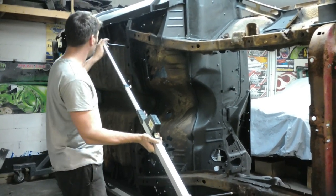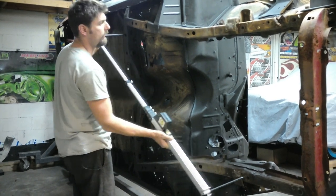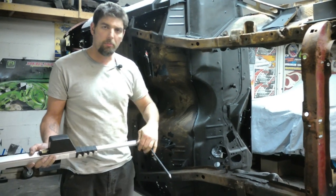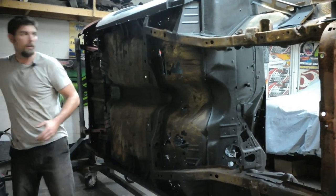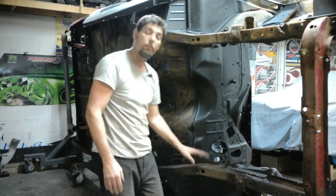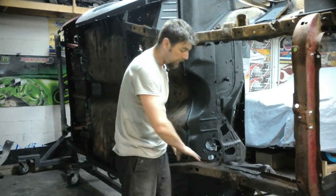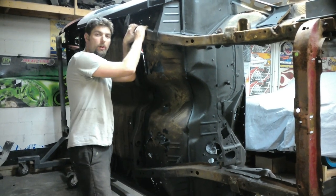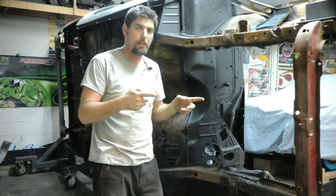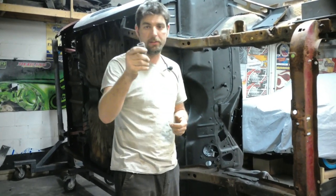Then you cross back over from there to there. This side's actually fitting a little better. Our frame rail pieces we think are moved a little bit, and the K-member off this car we believe got bent a little bit too. What we're going to end up doing on this video — we're going to cut from here forward. We're going to leave this section of frame rail in because we don't have the replacement yet. It's on order, so we're not going to cut it off completely because this area is in decent shape. But besides that, we're going to remove the whole front end of this car. I kind of timed these cars knowing this on purpose.